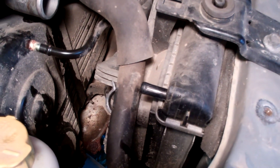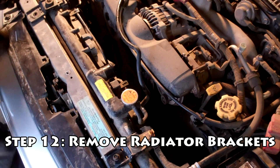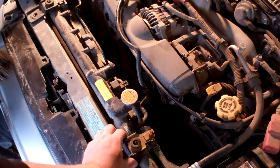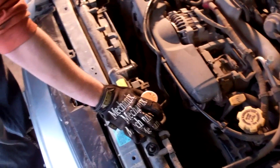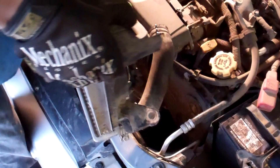Once you get the driver side connector out, come over and unclip the power steering line from the radiator if it's still clipped in place. We'll unbolt the radiator and get it ready to be pulled out. We have two 12mm bolts to take out — these remove the radiator brackets. Once you get those removed, place them where you're not going to lose them. Now the radiator is just about ready to come out. Watch for the power steering side — there's a small metal hose that will interfere with the power steering line. Once you've freed that up, tilt the radiator to the driver side and you'll have coolant come out of the lower hose into the bowl below. Remove the radiator and set it in a spot where it won't get damaged.